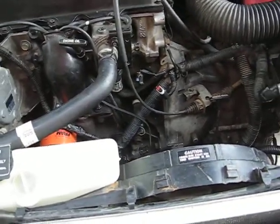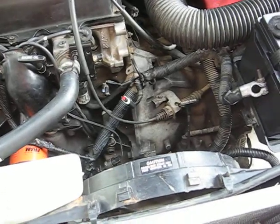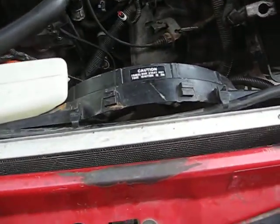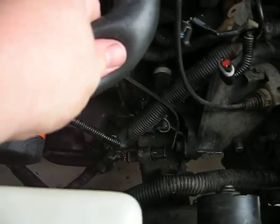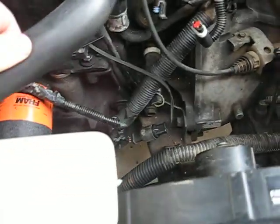Car wasn't overheating. I was told that if the thermostat was working and opening and closing, that once it opened up the fan would engage. And that happened — the fan turned on. As you can see, you can kind of hear that there's more coolant in there. It feels like there's some pressure in there now. As I push on it, you can hear the coolant, and then more so at the bottom. There's a lot of coolant down there.